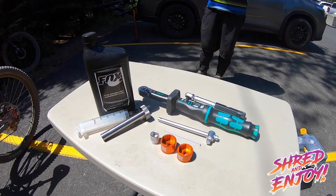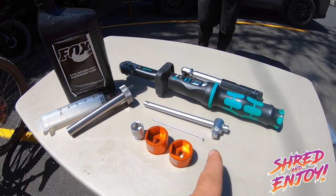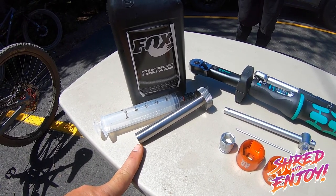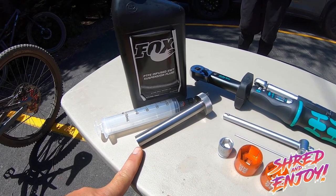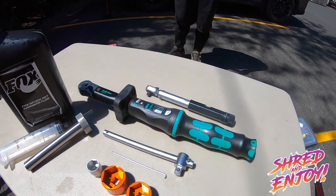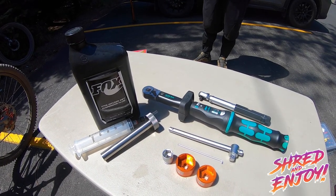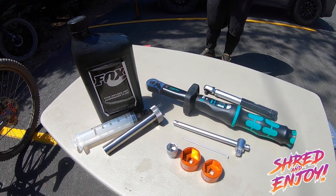So this is what you're going to need to do the job: 26mm, 28mm, 15mm sockets, a little 2mm Allen, a ratchet drive, this little proprietary tool to pop out the damper that's currently in there, 40ml of fluid, and a torque wrench — possibly optional if you want to get really specific. Hopefully this does the trick and we can do this in the parking lot right now. 60% chance we're 100% okay.